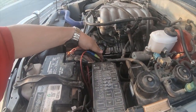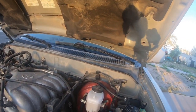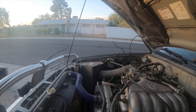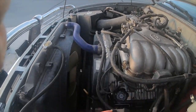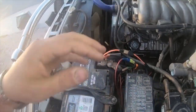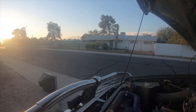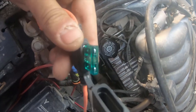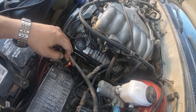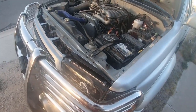I need to zip tie the fuse down. Let me open this to show you real quick — it's got a 30 amp fuse, it's green, it's an ATO fuse. Should be good — even if I need to put a bigger horn in or anything like that, it's already set up. I just unplug the air hose, run the air hose to the new horn, and it's all good.